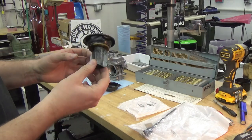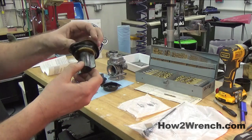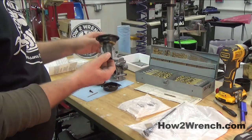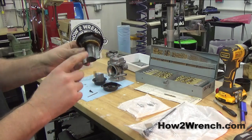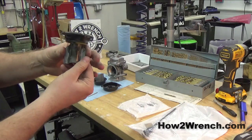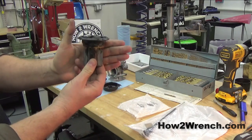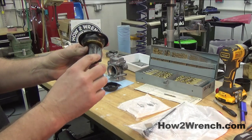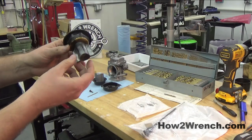The lesson in this video: I'm getting ready to change the CV slide. A lot of times people just change this because it's torn or the rubber has shrunk or stretched out to where it won't fit nice in the carb body. Something that's often overlooked is the physical condition of the slide itself. On a lot of carburetors they've gone to a plastic slide. On the intake stroke this thing gets sucked forward — even though it's an up and down movement — and as it comes back up it goes back. We've got some pretty big grooves in here.